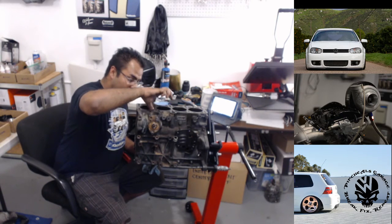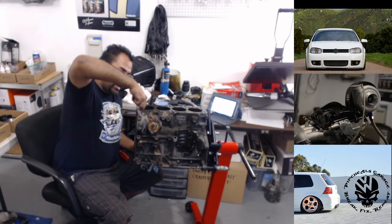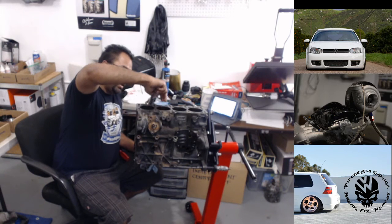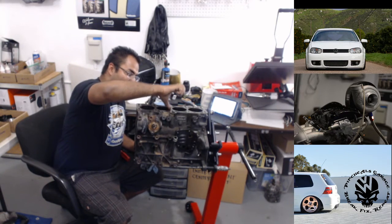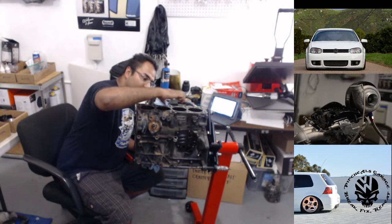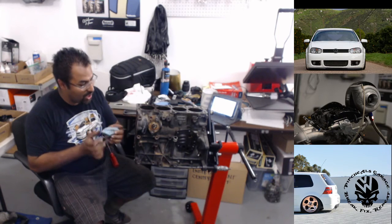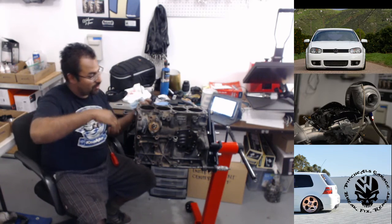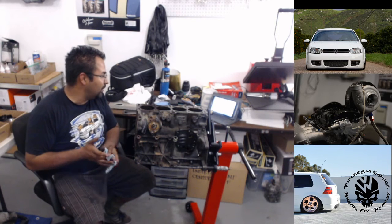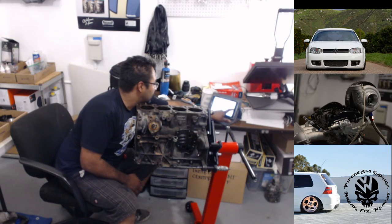Put your hand inside the cylinder walls and see if anything is funky. Feel for any offset, rounding. Because that's what's gonna happen when they take it to the machine shop, and they're gonna say, oh, this is what's wrong with this and that, and they might have to bore it, or they might have to machine it over a little bit. Little things like that. So it's useful.